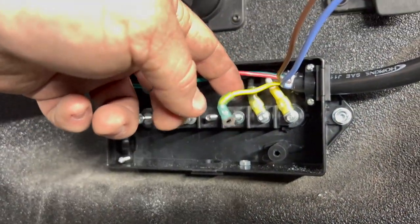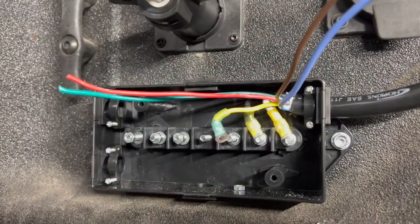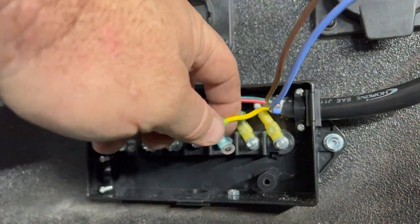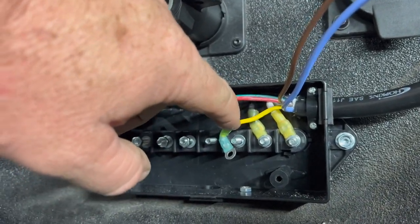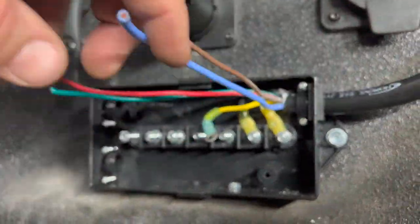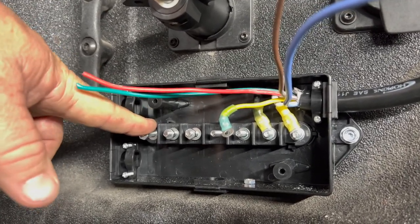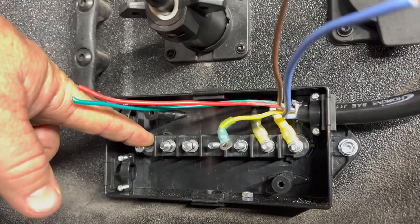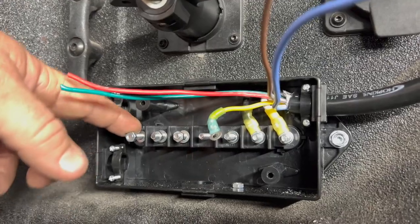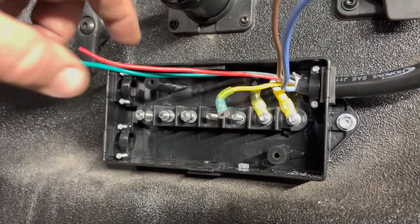White is the ground, power is through the black wire. The yellow wire is the auxiliary — that's literally your backup lights, so when you put your vehicle in reverse it sends a power signal through this wire. I'll hook this up to some spotlights in the back. Red, brown, and blue — blue is the brake wire. I'm going to run it and hook it up, but it really won't have any features other than maybe hooking it to some lights that get brighter as the brake controller engages. Realistically there's no use for that on this build right now, but I can hook these up to turn signals and stop lights and add some extra stuff.